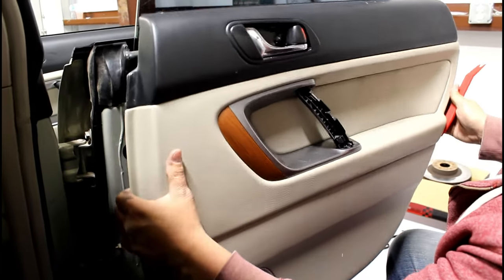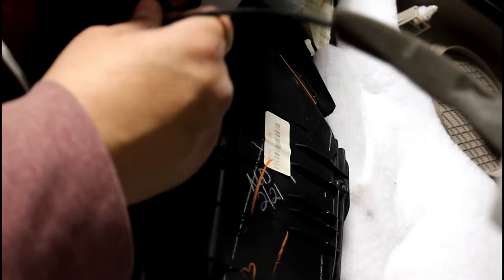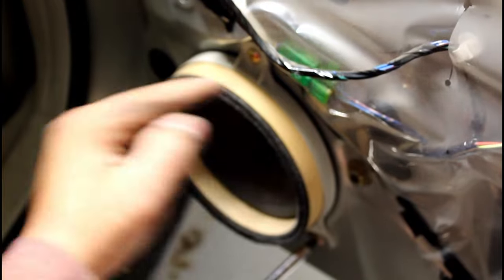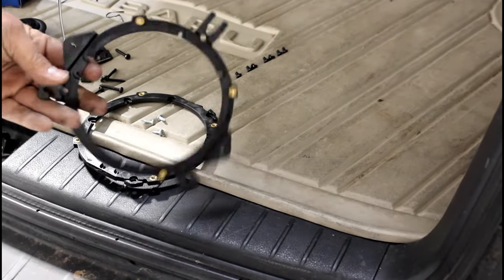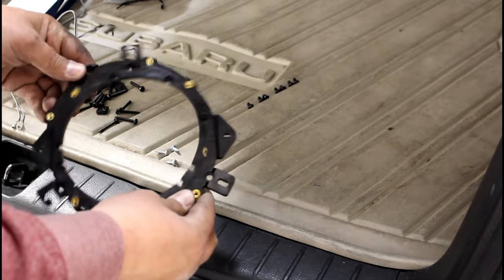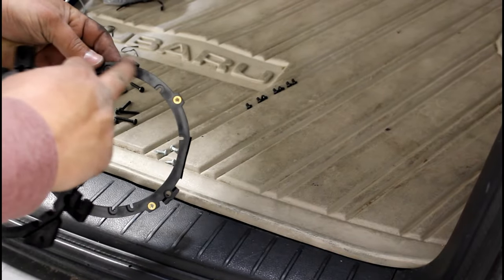Lift up — there's a clip for the wiring, just push it down and wiggle it off. Over here the door opens — pull the two wires out like that and they'll come out through the slot. Now take the door and put it down. There are three screws around the speaker — just pull them out. Here's the bracket that came with my speakers. I pretty much hacked everything off of it except for the part I can use for the self-tappers.